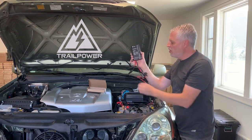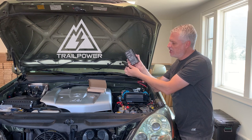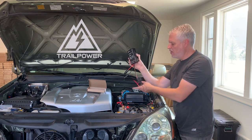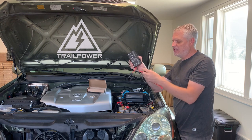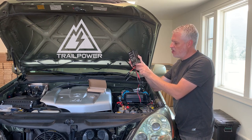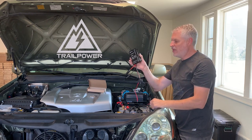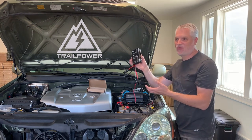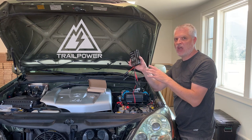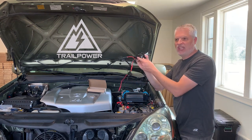On your controller there are five pigtail wires. A red and black positive and negative connect to the solar panel. Then there's a black lead to the negative battery terminal and a positive lead to the battery terminal — that positive lead has an inline 20-amp fuse you can replace if needed. There's also a thermometer pigtail that reads temperature in the engine compartment near the battery. This allows the controller to adjust charging to avoid overcharging or undercharging depending on temperature conditions. There are also indicator LEDs that give feedback.